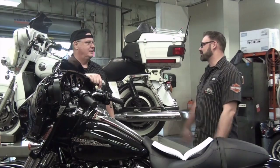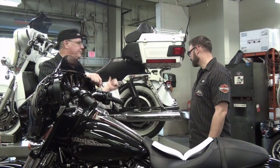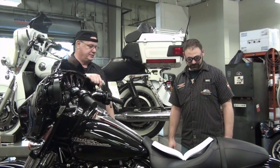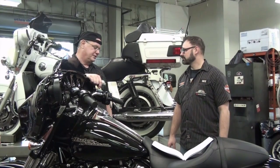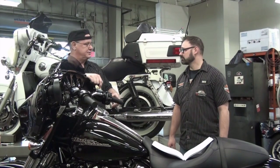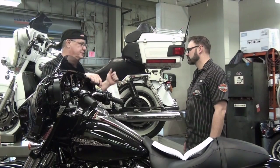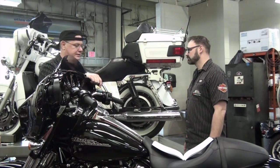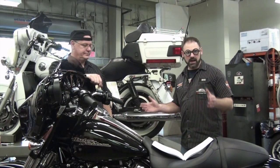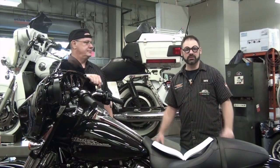Be talking suspensions, right Ted? Yes we are. We're going to talk about the new 17s versus the older bikes that are air over hydraulic. And as you know, Tate, these new 17s all come with the spring assisted coil over shocks that are manually adjusted, whereas the older ones are actually adjusted with air pressure because they're air over hydraulic. Awesome. So we're going to show you how to adjust both these shocks and the preloads and stuff like that. So stay with us.